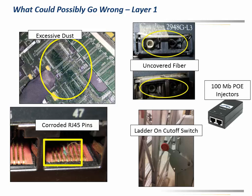Lastly, we have PoE injectors. As I get involved with wireless network upgrades — people going from G to N and now considering AC — sometimes they have external PoE injectors because their switch doesn't support it well enough. These PoE injectors are in the mix, so you should check them out. Make sure they're rated for the proper network speed. The switch might be a gig, the AP may support a gig, but the injector may only be 100 meg. Sometimes the injectors start to flake out and you get all sorts of crazy physical level errors, so you should know where those are in your environment.